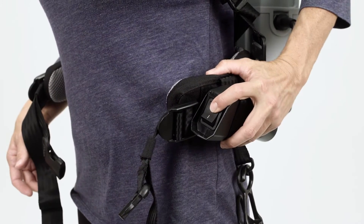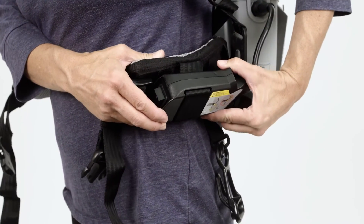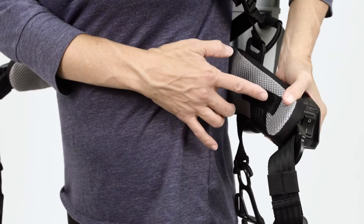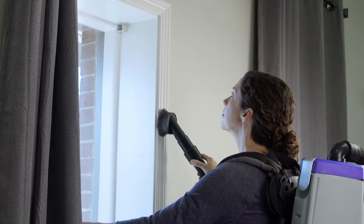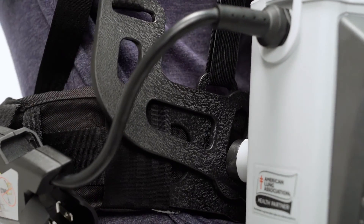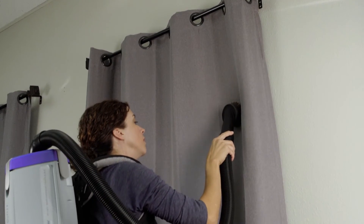The on-off switch is conveniently located on the waist belt of the backpack vacuum. The switch box is secured to the waist belt with Velcro running through the top and bottom of the switch box and then to the inside of the waist belt. Use the proper attachments for the job. Pro-Team has attachments to perform most jobs without requiring you to bend over or get into difficult positions. The padded articulating harness design provides increased range of motion during detail and overhead work, reducing operator fatigue and increasing productivity.